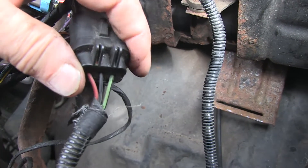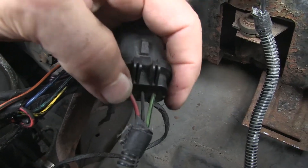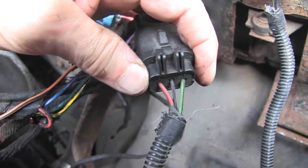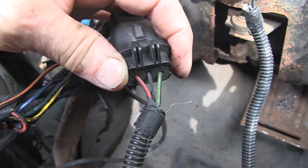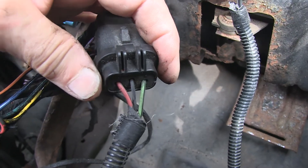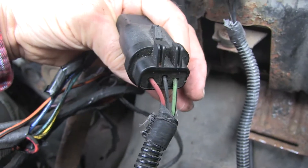I checked all these wires. I checked the ground over at the battery and checked the resistance to make sure the ground was good — it was good. This wire was lighting up for the high beams, this wire was lighting up for the low beams, so we knew the right voltage was getting out here. So it wasn't the ignition switch and it wasn't the directional switch, which has the high/low beam switch on it. We knew it was none of those things, so the problem was somewhere from here on.